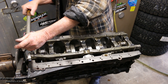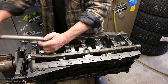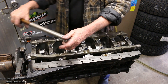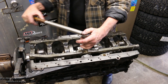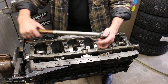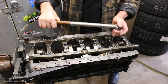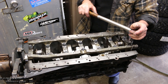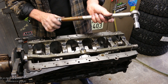There isn't a specific torque pattern we need to follow for these — they've all come down and we're just doing them evenly. It's not a cylinder head. Some would argue that a pattern might be important, but I think you're splitting hairs. For a cylinder head you would definitely want to do it in the correct torque sequence because you've got a gasket. Then the last stage is 60 foot-pounds.